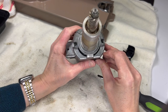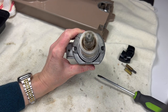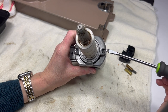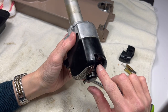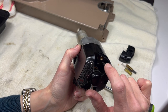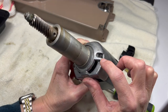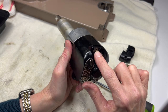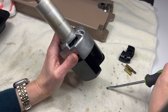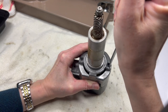The next step for taking apart this motor is removing two screws, one here and one here. I'll start unscrewing this. As I do that there's a little brass nut in here - it's longer than a typical nut and threaded on both ends. The brush screw screws into one end, and this screw is really long - it goes the whole body of this part of the motor and screws into the top of the brass nut. So when I unscrew this, the little brass nut is going to fall out eventually.